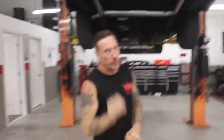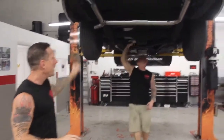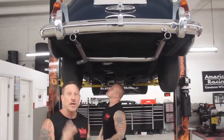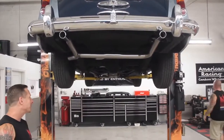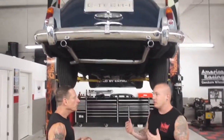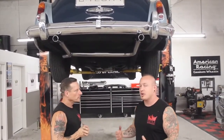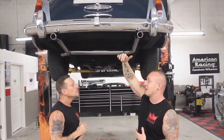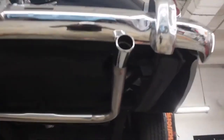Here we are at the end of this beautiful 1965 custom-made dual exhaust. It's a very challenging job because, like a Chevy with similar chassis, there's not a lot of room underneath to work. The whole system is now hand-fabricated, welded, and we used rubber isolators so there's no rattling like the client was experiencing before with the Subaru resonator and Magnaflow muffler. This thing came out great and looks super classic — fitting for a Rolls-Royce. We opted for dual exhaust rather than a single hidden pipe, with a classic-style rolled lip, two-and-a-quarter-inch chrome tip on either side, giving it the symmetry a big-body Rolls-Royce deserves.